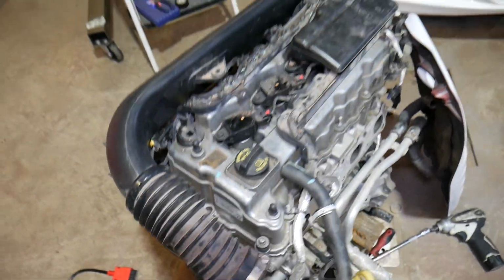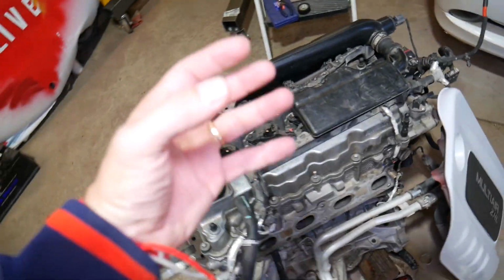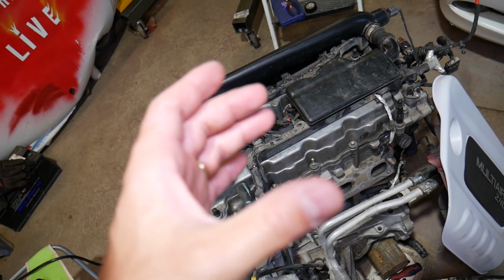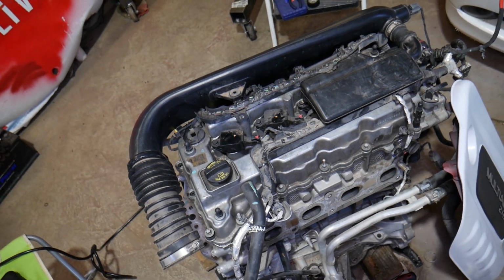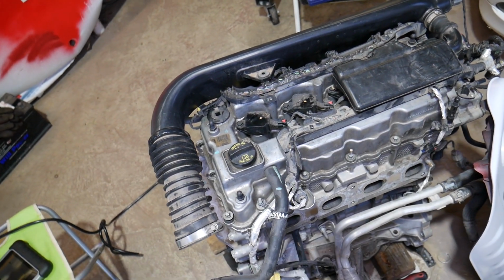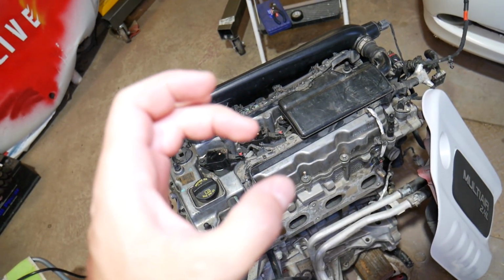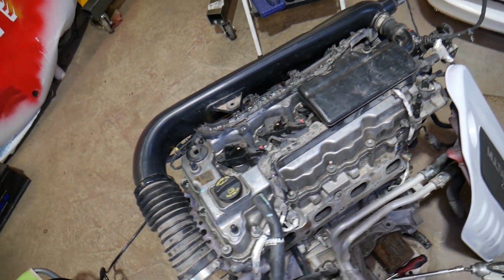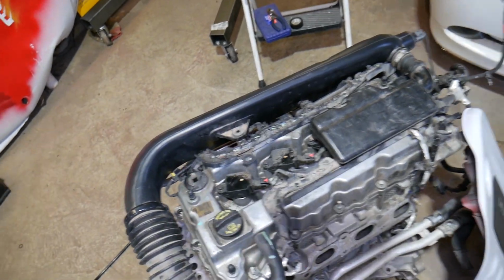You have a fuel regulator. I think the fuel regulator is integrated in the fuel pump. We made a video on the Dodge Dart, I think, but it's the same pump, I think, for Jeep Compass and Renegade, guys. The fuel regulator, okay, if it's not creating enough pressure, your fuel injectors will not be spraying enough fuel, and that will cause a lean mixture as well.